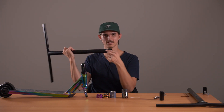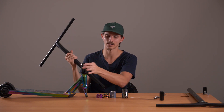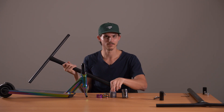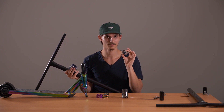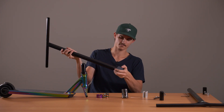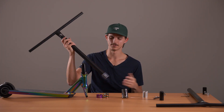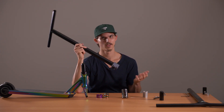Make sure to grab the larger IHC compression bolt that the forks came with, as that's what's going to work. Now we grab the oversized steel bar — it has a slit as well. As I said before, it needs to crimp in slightly to grab hold of the compression. This time we're going to use our proto clamp. Slide the adaption shim out — that one is for standard bars. So this clamp does work with both. Now that we've got that clamp on, we would slide it over the compression, make sure the bars are straight, do the two bolts up, and we're good to go.